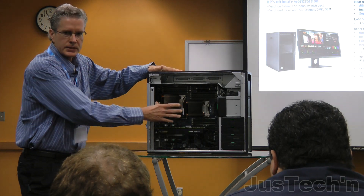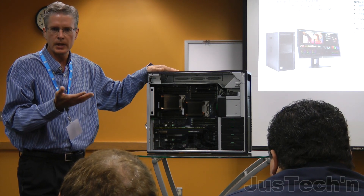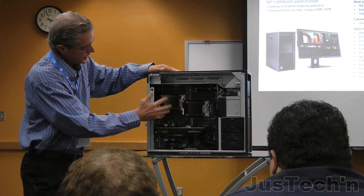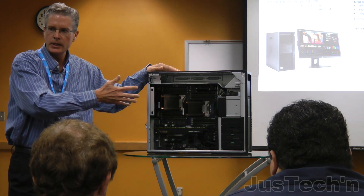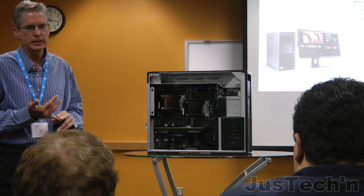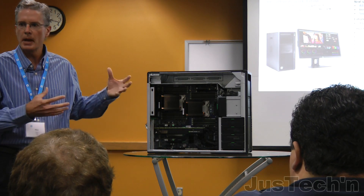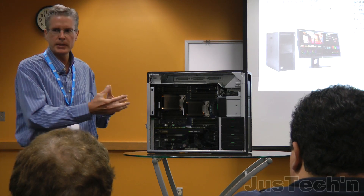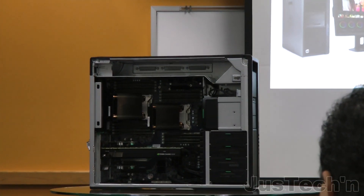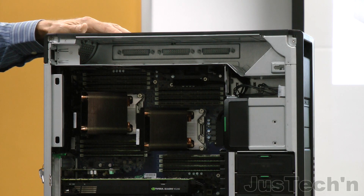What's exposed here are the two Haswell processors. We'll support the same processors Travis talked about on the Z640, but we'll add a higher-power 160-watt processor not supported in our mid-range platform. Just as on our previous Z820, we have 16 memory slots providing DDR4, just as the other platforms. That gives us higher performance, clocking up to 2133 MHz — a 14% gain. With more cores, you need more memory to feed them, so as computational power increases, memory performance and capacity must go up. This system is enabled to support two terabytes of memory when 128-gigabyte DIMMs are available.